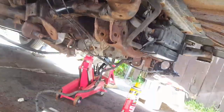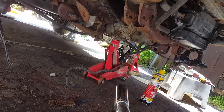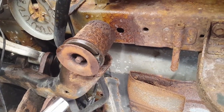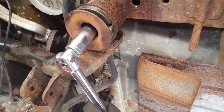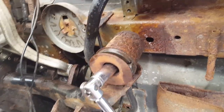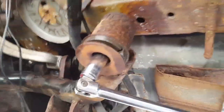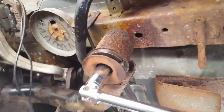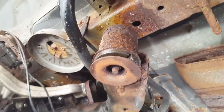I'm going to use a 3/4-inch long socket to break these. I'll heat the first one up, break it, then do the second one, and then remove those brake line bolts. The first one broke pretty easily — I'm going to spray it with a little more penetrating fluid. There's a chance I broke this free in part 3 because it did loosen up pretty easily. I'll spray it a little more and do the other one.